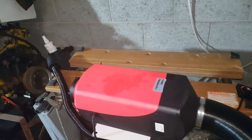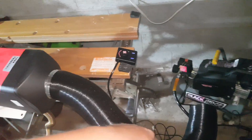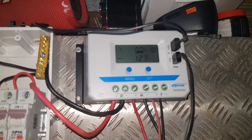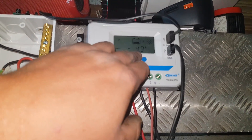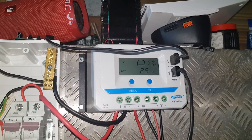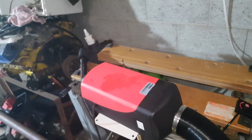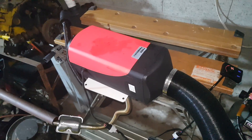That's it burning now. It's not overly loud — a bit of wind speed kind of noise because that's an open vent. Normally you'd have a curled pipe off that. I'm straight off the 12.3 volts up top here. It's pulling 4.3 amps because it's running the glow plug again and the fuel pump's going full noise trying to get it to reignite because it's gone out. We'll come back in a minute when it's settled down.